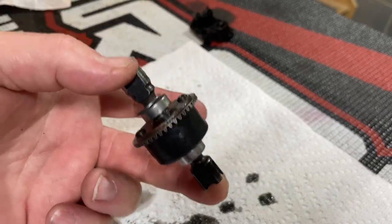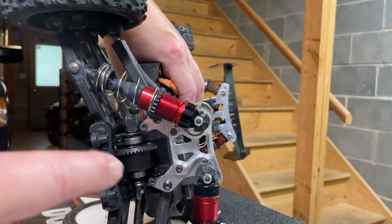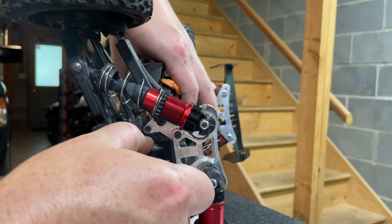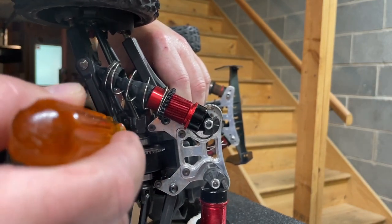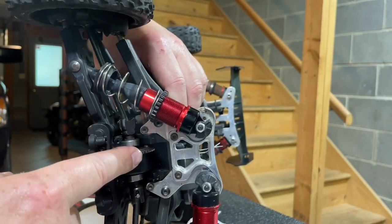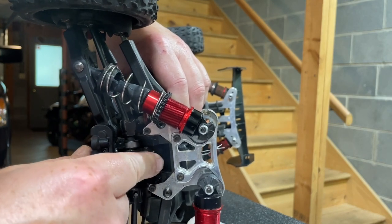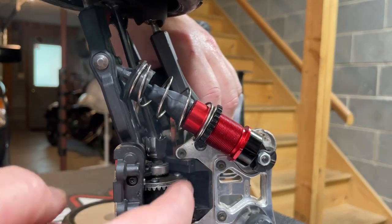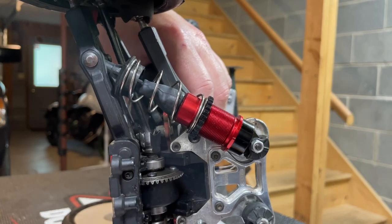Here's a little trick when putting shims on your differentials and getting them back in the case: tip the car on the side opposite the shims. Since the shims are on this side, tip it on the other side and the shims will fall into place in that little slot a lot easier. You won't fight with them as much — the shims can be a little bit of a fight getting them to stay against that bearing in the slot. Tipping the car on one side when you do it makes your life a lot easier.